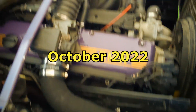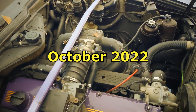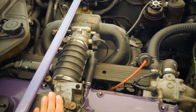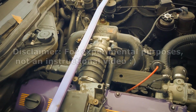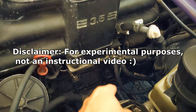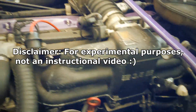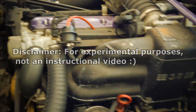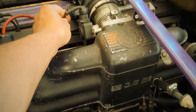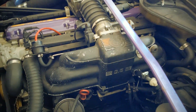It is that time — I'm getting ready for the manifold swap. So I'll take all this out, lift up the strut bar, disconnect the battery, disconnect the fuel hoses, and then I should be able to get to the bolts that hold the manifold to the cylinder head. The time-consuming part is probably going to be lengthening these cables, which shouldn't be too bad.